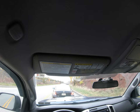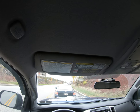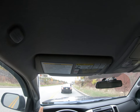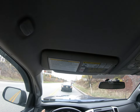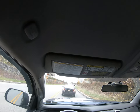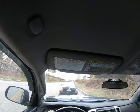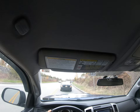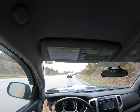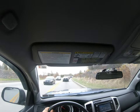I take it back to the dealership and they say it could be the rotors causing a pulsation. But it's under acceleration, not under braking. I said what the hell, because I do have a little bit of a pulsation under heavy braking. So I get the rotors cut, and it makes it a little nicer under harder braking. But under acceleration it's still vibrating anywhere from 55 to 70 miles per hour — no change.